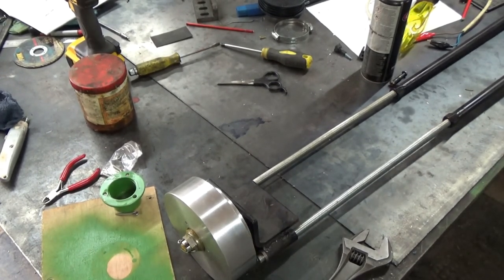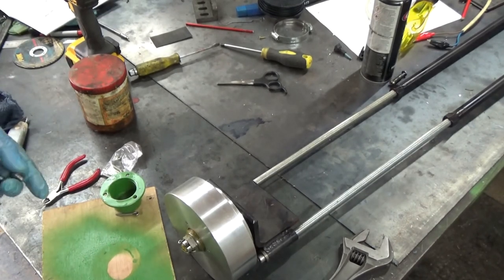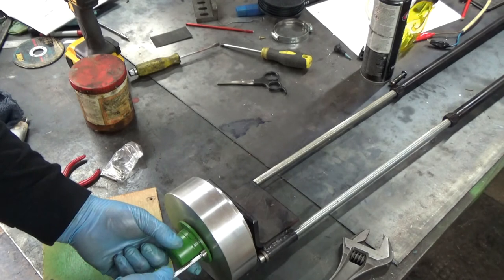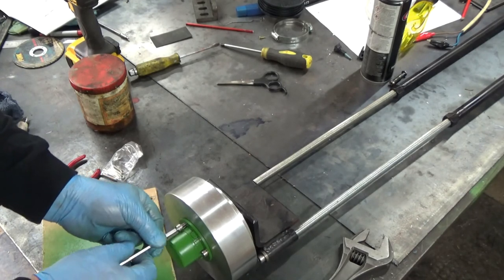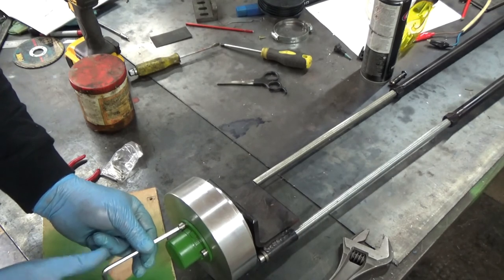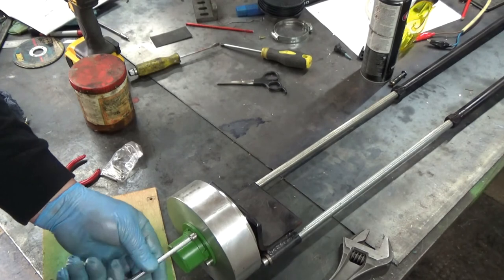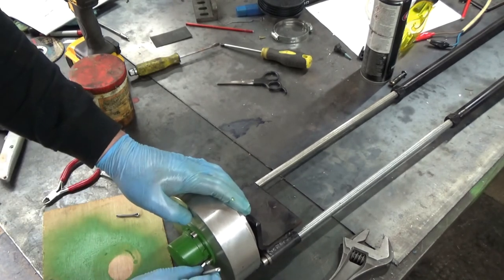There are many more things you come up against when doing wheel bearings. Installing wheel bearings is another thing entirely — I do them manually with a punch, but doing it manually is not for the faint-hearted. Although I've installed thousands and thousands of bearings, I think I've destroyed four or five, just because the punch slipped down the face of the bearing. If it does that it marks it — game over, you need a new bearing. Some bearings are very expensive. Anyway, both my wheel bearings are done — happy days, onwards and upwards onto the next project.